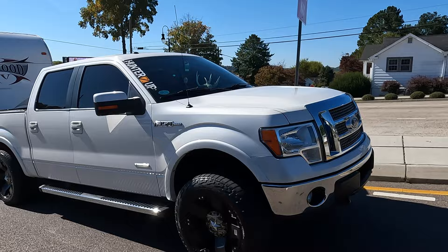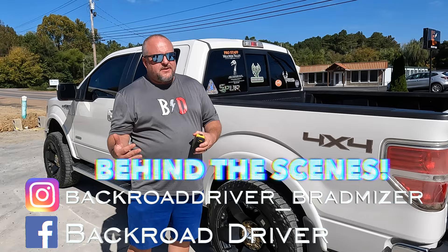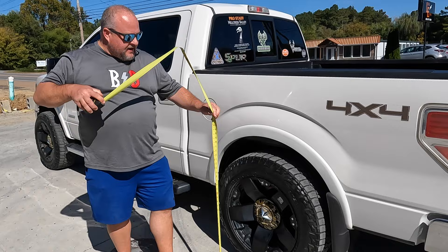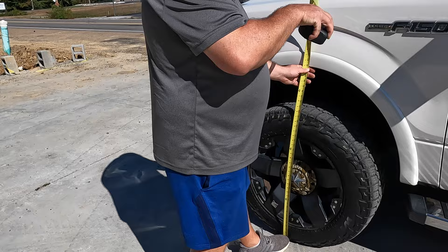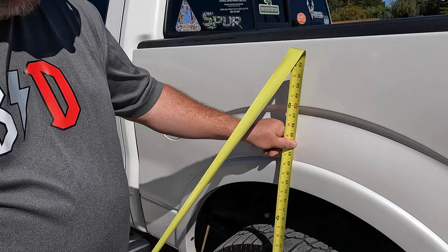Let's head to the garage and get to work. This 2012 F-150 has seen quite a bit of action back here over its lifespan, so these leaf springs are a little more worn out than a brand new truck. A lot of you guys are going to see this type of squat be pretty typical on what you're driving. From the ground to the fender liner we're just under 37 inches in the rear, and up front we're just under 41 inches. We got it unhooked and it's like a little over two and a half inches of squat left just from unhooking the truck.